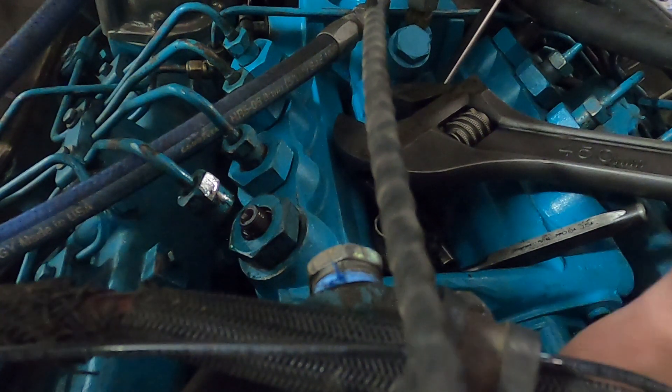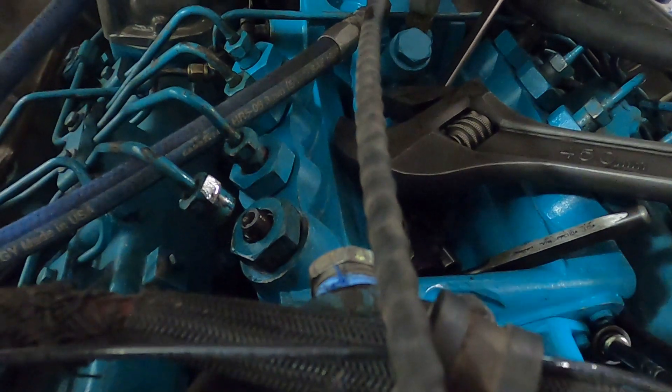If you want to set it at 25 degrees, you put the engine at 25 degrees on the damper and do the exact same thing - you're just setting port closure for wherever the engine is. We're going to take our 3/8ths 12-point socket again and reach in the front here and tighten up that bolt on the front of the hub. Then turn the motor almost a full rotation, tighten up those other two bolts, put the delivery valve back in, put the line back on, and button up everything else you had to take apart. And that's all there is to it.